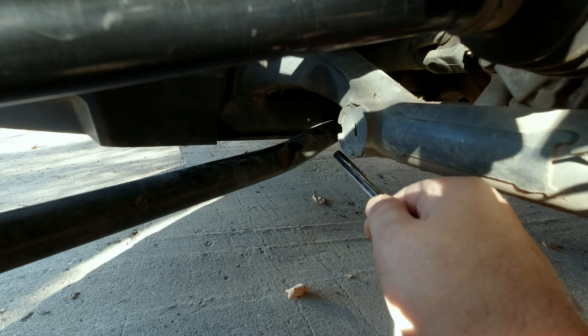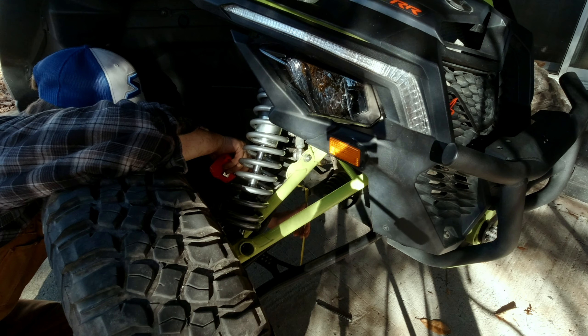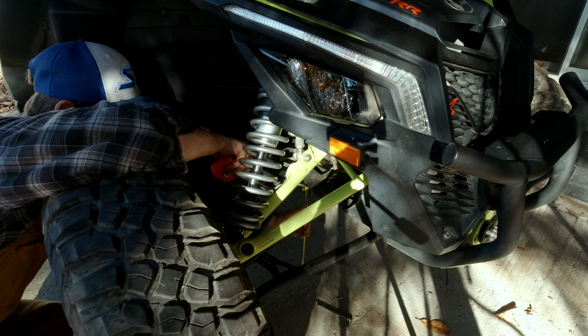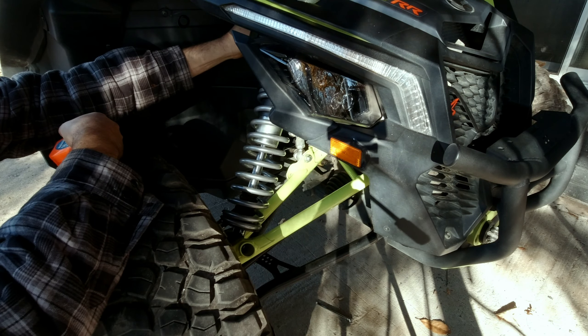Measuring from the bottom of that bar, we're a little under 14 and a quarter, so subtract one and that's around 13 and a quarter. We're going to have to come up a good couple of inches to get into spec. I contacted Shock Therapy to confirm that was within the realm of acceptable adjustment — they said I should have no problem and the 64-inch cars like a little more preload anyway. It's going to be about a two-to-one ratio on the spring, meaning if I compress the spring one inch it'll bring the ride height up two inches.